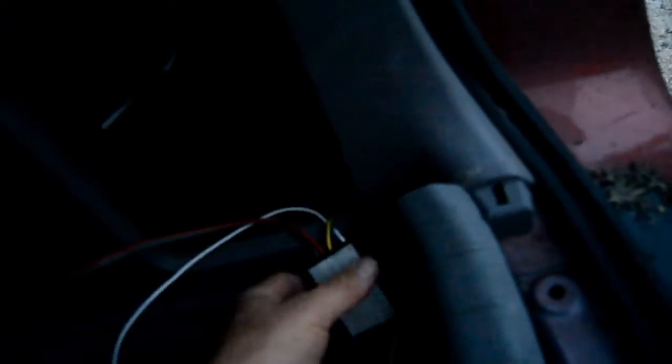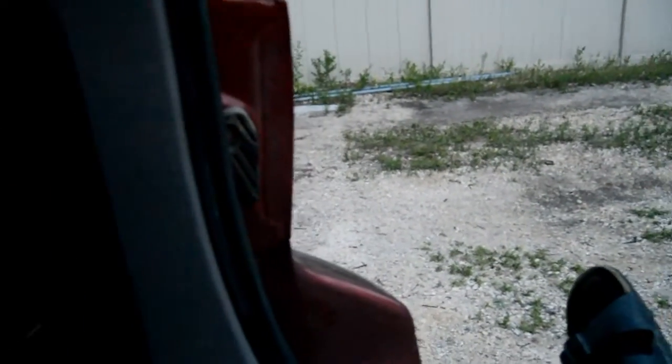I'm starting to lose light here, so this is going to be a little difficult to show you. I took my jack out, and now what you need to do is tape your module with the double-sided tape somewhere against your frame. Find a spot where it's not going to interfere with the jack — perhaps up here would work. Then we have this white wire with the eyelet, and we're going to find a place along here where we can drill a hole and ground our trailer connector. This is an important step because you need it for continuity, but you want to make sure you're not doing this somewhere on the body where you're going to hit the exterior of the vehicle or somewhere exposed to the elements, because it will rust.